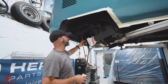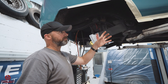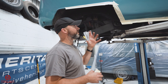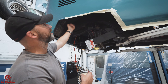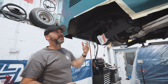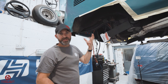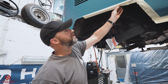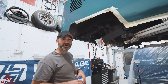We are going to be protecting the wiring — there's some wiring pinned up underneath that will get brought down and covered. The central column, which is the heater channel under the centre of the vehicle, is going to get covered in plastic. I can't go around every nut and bolt, so I'm going to have to be pretty good with my aim. Once I've finished underneath, any overspray on the arch lip will just need a bit of brake cleaner or panel wipe on a clean rag wiped off while it's still wet. We're going to spend a bit of time masking up underneath and around the sides, bring up the skirt, have a spot of lunch, and then get straight on with applying the under seal.